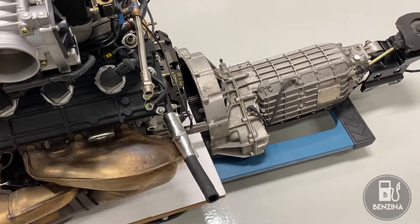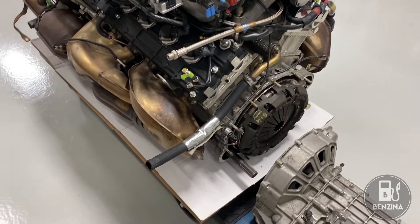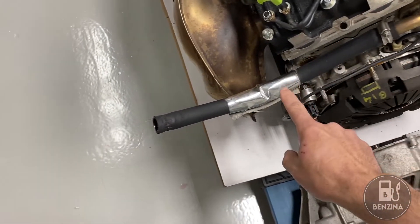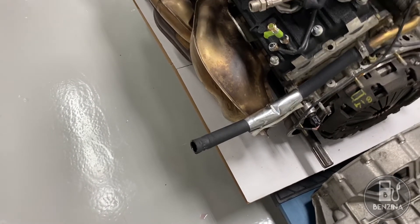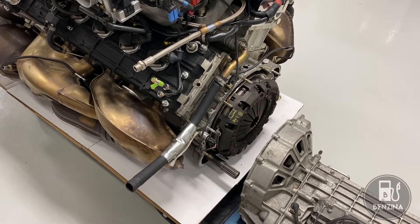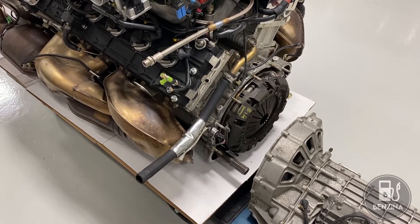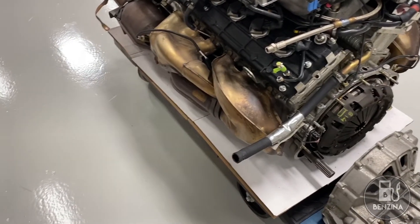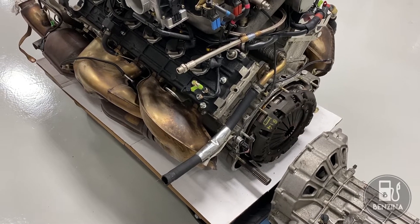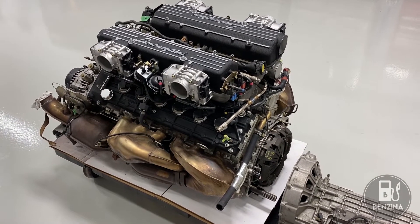Hopefully this gives you an appreciation as to where the hose that everyone talks about — the hose that fails — is located. Changing it is a super easy thing. You lose coolant and the system needs to be refilled and bled, but there's just one hose clamp here and one hose clamp that goes to the coolant bottle in the engine bay. If this hose fails, it will leave you at the side of the road and you will be getting towed home. It's the most common failure item on a Lamborghini Murcielago. Easily fixed, and in total between the hose and the wrap I'm into for about $30 or $40 in materials — certainly not worth a tow. Good driving in the upcoming driving season.